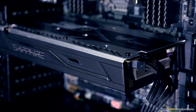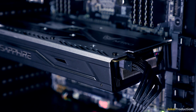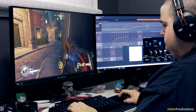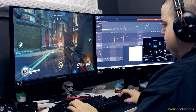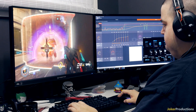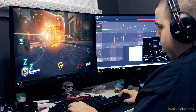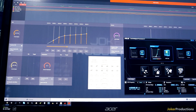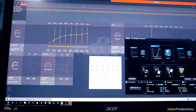Running the card at idle, I saw it mostly sitting at around 45 degrees Celsius at the desktop. But when I went into actual games and started getting things ramping up in something like Overwatch, running for over an hour, I would usually see temps settling at around 75 degrees Celsius, with the card being able to maintain over 1300 MHz on its boost clock. It's supposed to go all the way up to 1342, but I found it maintaining at least above 1300, which is more than I could say for the reference RX 480.